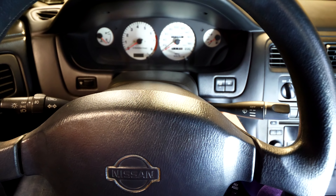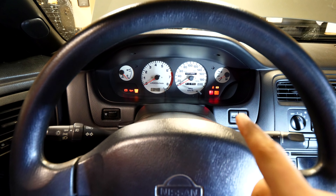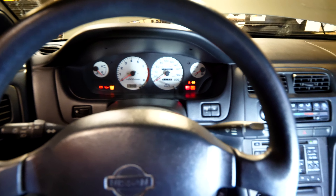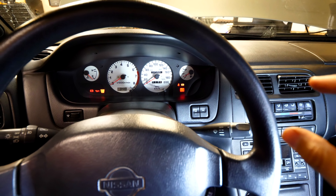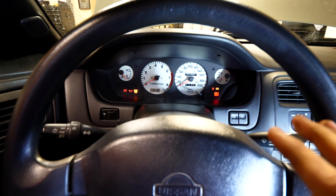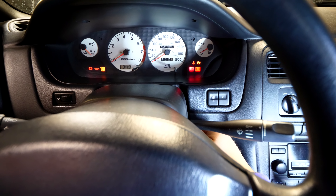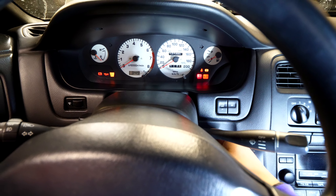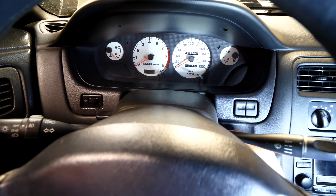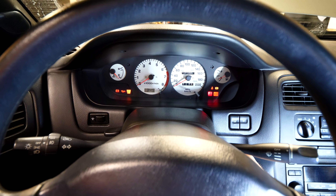The next step begins inside the car. Grab your key and turn it to the on position so that the fuel system will prime the fuel filter. Once that's done the fuel filter is going to be filled up with fuel, allowing you to turn on the car without starving anything of fuel. You're going to cycle that about three times total, and then you should be able to turn on the car and it should start up right away.